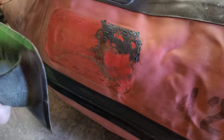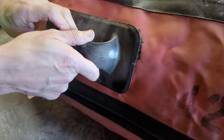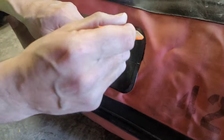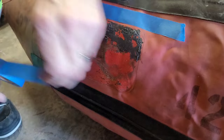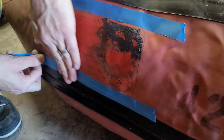If you're going to be installing a new handle on your boat, lay the handle out on the boat right where you're going to install it, use a pencil to outline it and then mask it off so you know the areas that you've got to glue. If you're just reinstalling the handle, just mask off the areas from where the handle was previously installed.